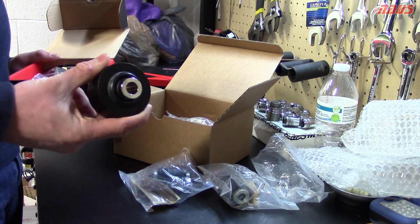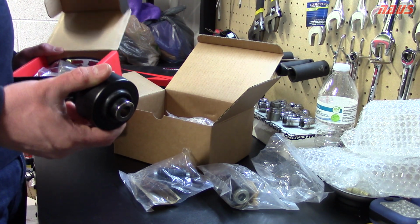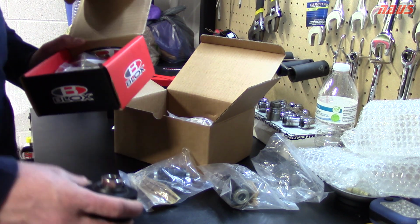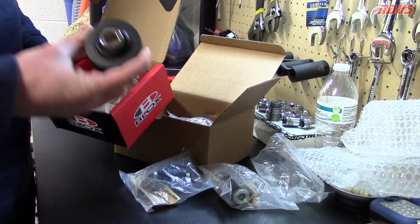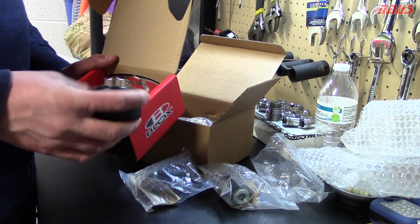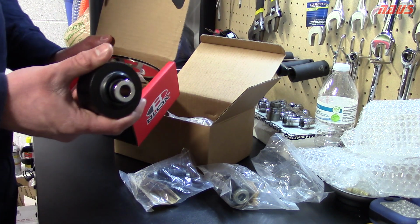I'm actually going to purchase a set of hard race hardened rubber bushings for the front control arm as opposed to these. They're harder than stock, so they'll keep the control arm stiffer than stock, but they also are more daily driver friendly. So I plan on driving the Si a lot more around town, back and forth to work and stuff in the summer. So spherical might be a little overkill. I don't really plan on running the car back at the track since I already ran the hell out of it when it was all motor and of course when it was supercharged. So it's going to be a little more of a daily driver now. These parts aren't really necessary.